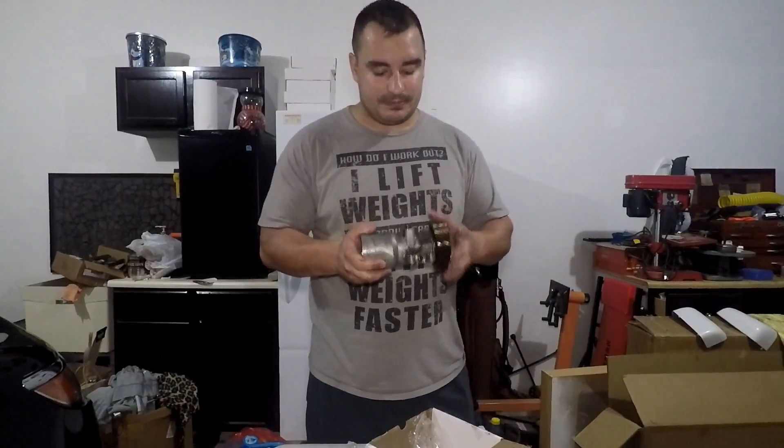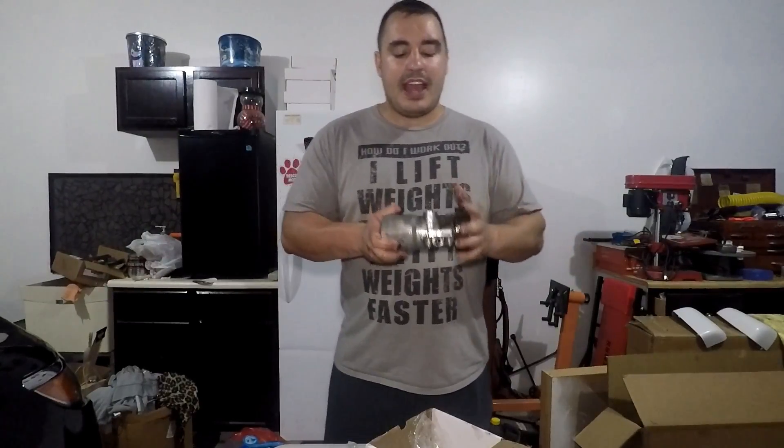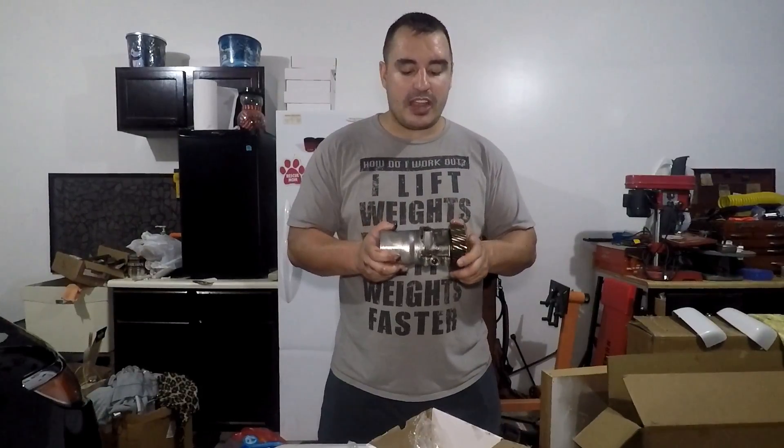As far as the stage one goes — if you are running a 205 CC injector or smaller, this pump is going to do you just fine. If you start getting to the 225 CC you're probably okay, however if you spend a lot of time at dyno events or at the drag strip you might want to go up to their stage 2 pump.